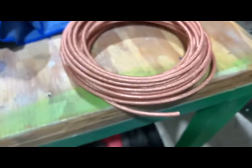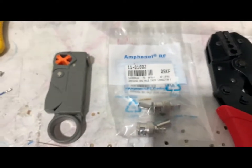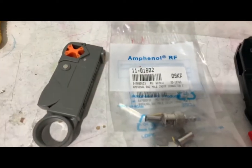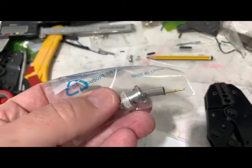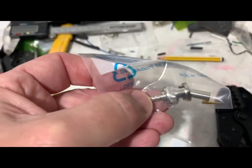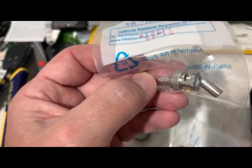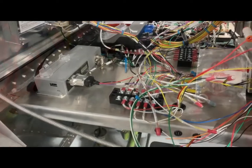I've got to wire up two BNC connections. I've been practicing - here's my RG400 cable that I'm using for all my antennas. I just got my packages in from Aircraft Spruce - these are two BNC connectors. They have that small little pin you've got to put on, along with the other part, and then that little collar sleeve. You put that over there and crimp everything on so I'll have a BNC on both sides.